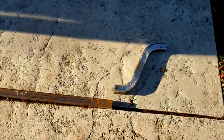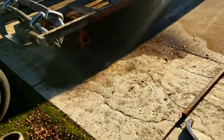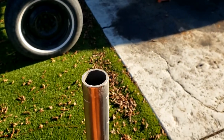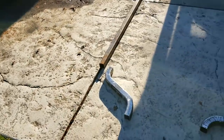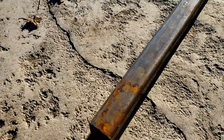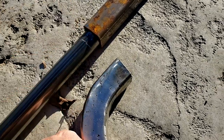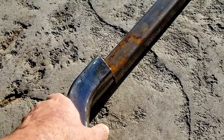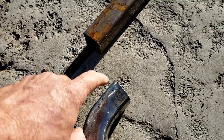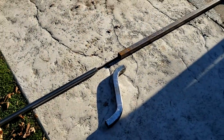So this piece and this piece will be welded to those frame rails, and on the inside there will be this tubing, which is the exact diameter as the height and width of that tubing. It'll go in like this — because it'll go inside — and then probably about 5-6 inches will be on each side. Holes are drilled on four sides and welded in, so it's very stable.